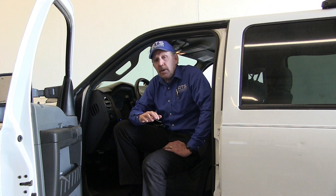There's already been some work done on the vehicle. The tires have been replaced, and all the U-joints, front and rear shafts, have been done as well. We need to diagnose this car, so we're going to need additional tooling — an NVH. What we're going to use today is the NVH by Automotive Test Solutions, referred to as the Intelligent Vibration Analyzer.